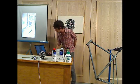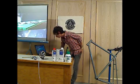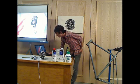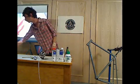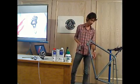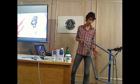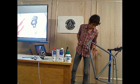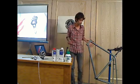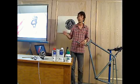After the priming process, then we go to coloring, and sorry, these are a little bit out of order. Basically, you'll put down a first color wherever you have any kind of decal work. Usually at the places I've worked, which is 7 Cycles and Cielo, we painted on decals usually. Usually you go by order of lightest to darkest color, because you want your white layer down first and then have other colors. It's easier to put a darker color over a lighter color than vice versa. It's harder to get that hiding.